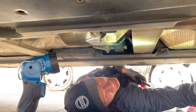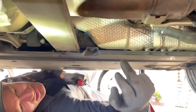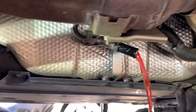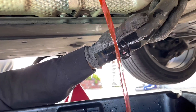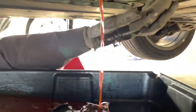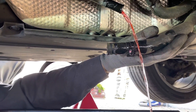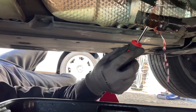Right away, what's really different here is we have coolant lines going to this piece of exhaust, and that's where it gets the extra heat from to make the heater work better. We'll see this piece better when we pull it out. There goes the whole coolant system emptied out — the radiator, the engine. It's probably the lowest point right now.